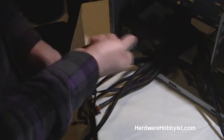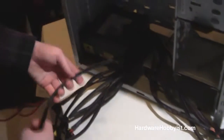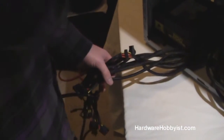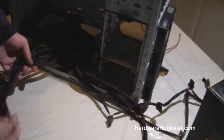For this card we just need one PCIe — so we're going to stick that. This is the SATA power — definitely going to need one of those. And then the PCIe power — need one of those. That's basically all we need. But just in case we need a Molex adapter for the fans if we don't have enough plugs, I'm going to stick one of those in here too. That is all we're going to need for now, and that means that the rest of these we can tie off with a few zip ties and tuck them under a hard drive bay that is unoccupied, or stash them somewhere else in the case that is going to be free.